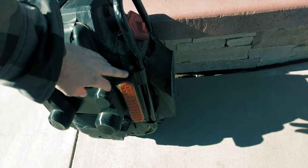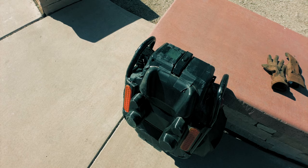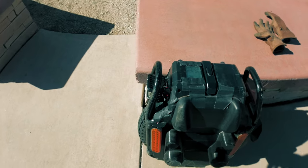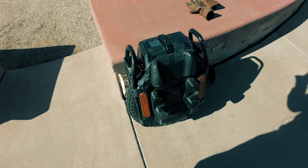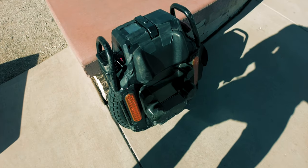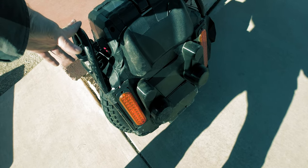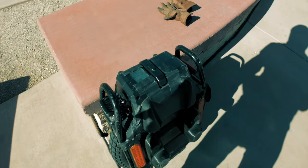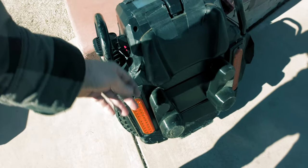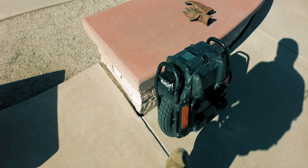The second major upgrade is these lights. I tried to do flashing lights — like fake construction hazard lights, orange — with 20 different flashing modes and a sync cable, but I could never get the sync cable to work. They would go through once per cycle and one of them would lose sync until all four were on different flashing modes. So I got rid of those. These are just turn signal running lights — one dim mode and one bright flash mode. I have them in dim mode and they are bright enough to light up the area around my wheel, which is great for visibility. When it's pitch black outside you can see the area immediately around you.